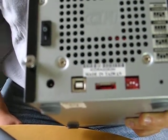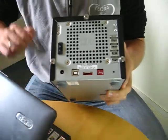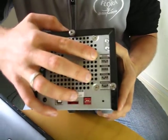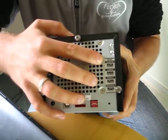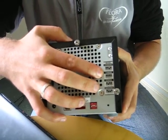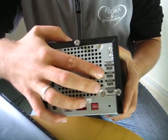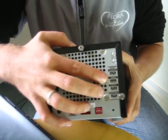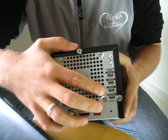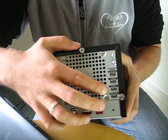Once set up, the unit is very simple to use. It has four basic functions. The first is standard mode, seeing both drives separately. The second is combined mode, where both drives will be seen as one drive. Thirdly, striping mode, where all the data is striped over the two drives.